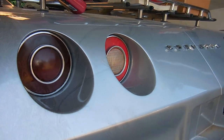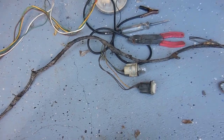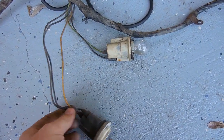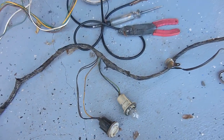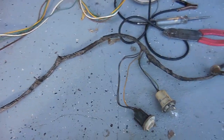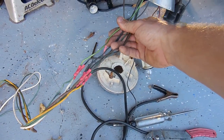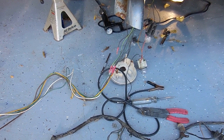Getting all that stuff working, mounted, and ready to go. Luckily for whoever buys this car from me, I have a complete rear wiring harness — I believe it's from a '79. The only difference is a couple of extra wires for the power antenna, which this car doesn't have. The sockets are all identical: three wires for the stoplight, two for the reverse light, and these are the marker lights. The license plate light is a separate harness, at least on this '74. The plan is to splice it in about here, which will make the harness a lot easier to deal with and cut out all the bubba — just one set of connections.